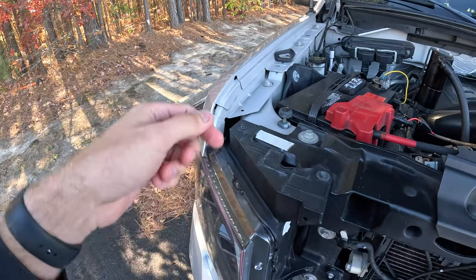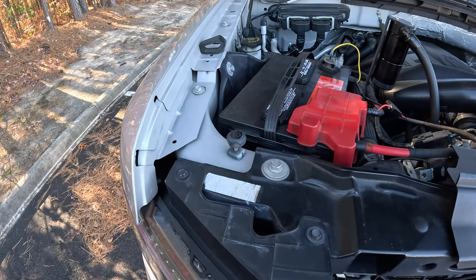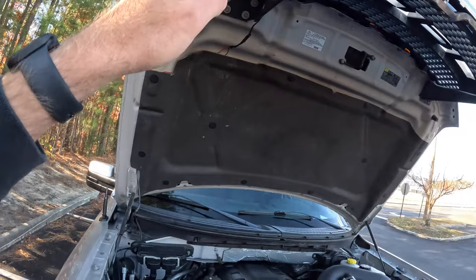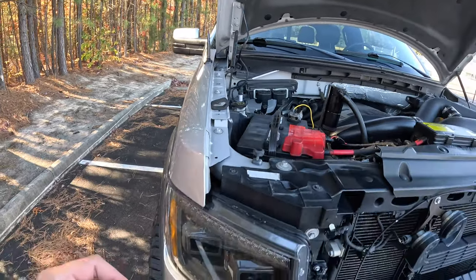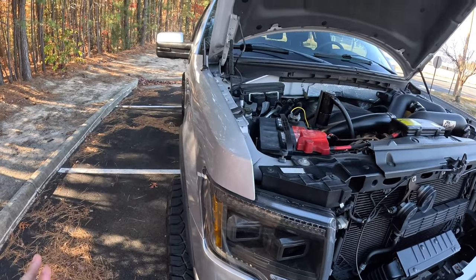So you've got to take your headlight out and splice in. You're pretty much going to have two outputs and one input. The parking light and this power are on one side, and the power from the actual truck harness is on the other side going into it. Really simple. If you've done any wiring before, this is the basic of the basic.